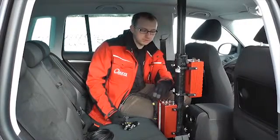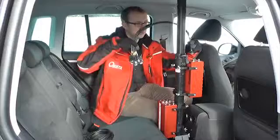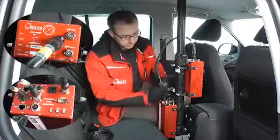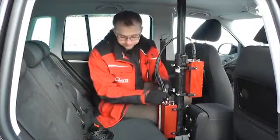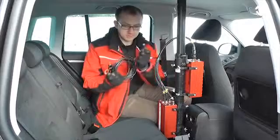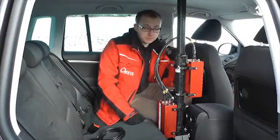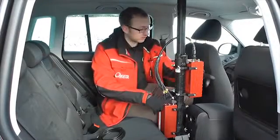We've got the RT and the Hunter set up in the vehicle. The RT feeds directly into the Hunter box. We're using an RT3000 series where we've got the user cable. The user cable goes in the top and we've got three ethernet ports on the front of the Hunter — it doesn't matter which one you use. The power feeds into one of the lower two outlets on the front; the top one is reserved for the RTXLAN. The RT gets its power from the Hunter, and the Hunter is powered using a standard M12 connector into the front. We do have an RT UPS available which supplies a clean 12-volt power supply, and if you're using a UPS then you power it between the Hunter and the RT, as opposed to from the Hunter to the power supply.